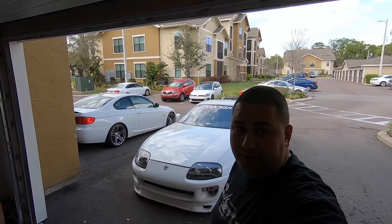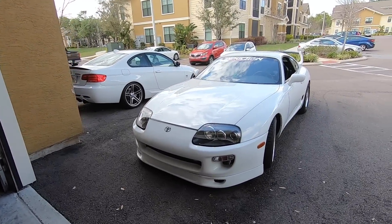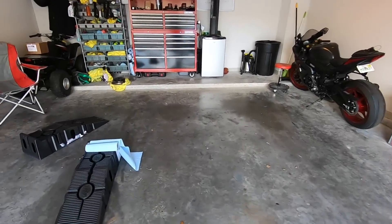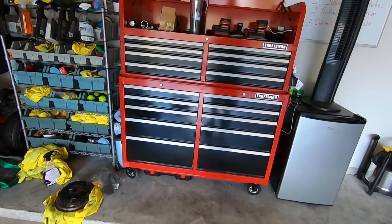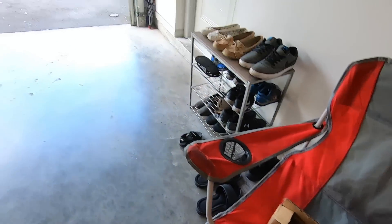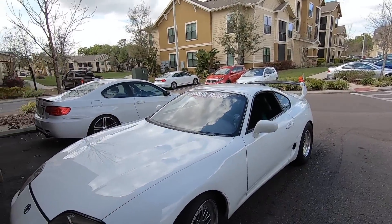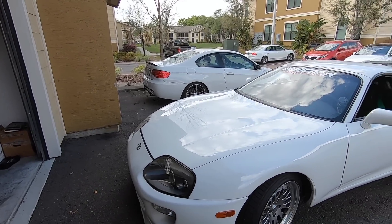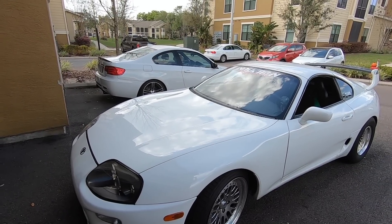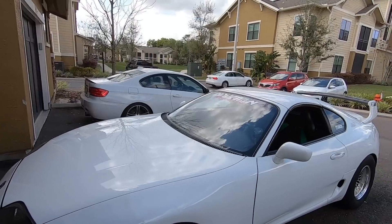What's going on guys? I know it's been a little bit since I've uploaded a video and it's just been a little slow around here. But today we are going to try to solve a problem. One of the issues we've been having is that, just because it's a cheap eBay turbo kit, the turbo in the manifold is pressed right up against the wastegate. When we drive it and the wastegate opens up, it's blowing flames directly into the turbo — and that's how we think we ruined our first turbo. We put a turbo blanket over it hoping that would solve the problem, but the turbo blanket pretty much caught on fire and disintegrated. So since then we bought this little kit that has a dump tube that kind of turns.